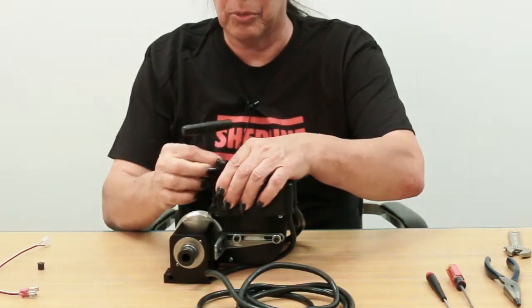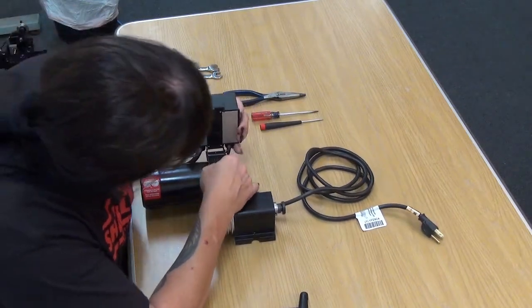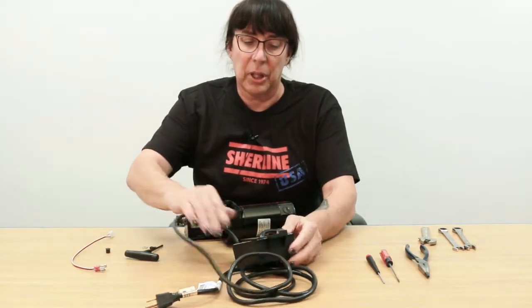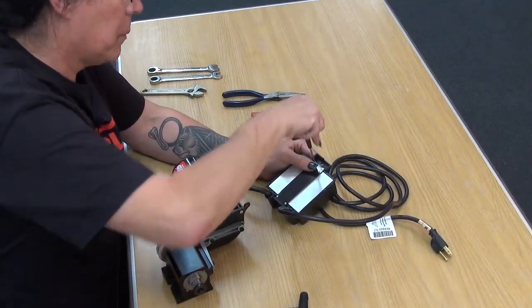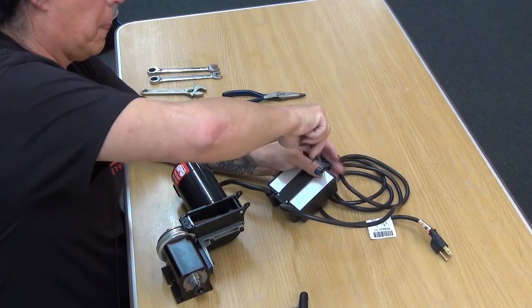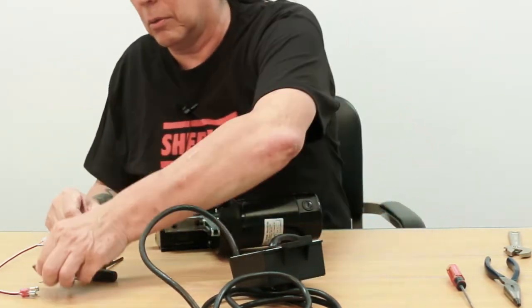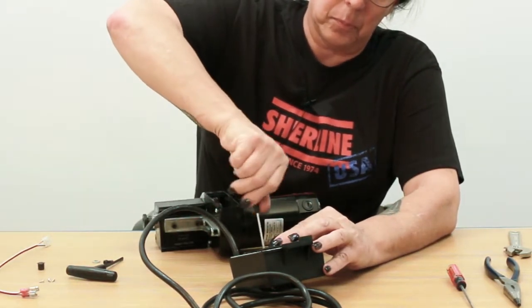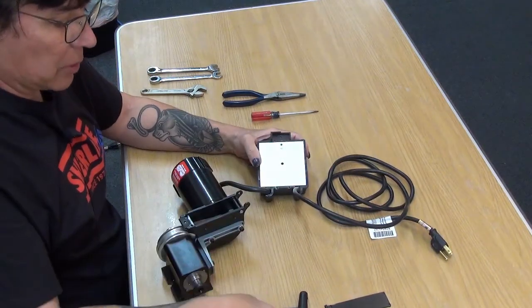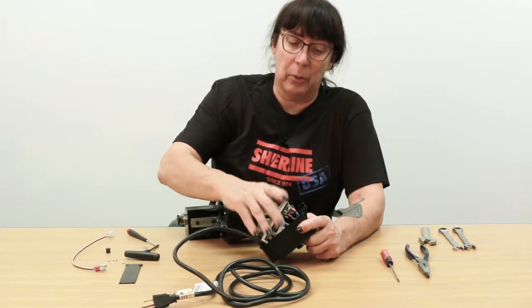This should be familiar for changing belt speeds. What you want to do is pop the little hinges off, just like that. That allows you to get to the bottom. Take your small Phillips screwdriver and remove the four Phillips screws holding the retaining plate on. Don't lose them — they're shiny and they disappear in carpeting. Now the easiest way to get the actual speed control out of here is to take the 10-32 bolt that holds the cover on and thread it right into the speed control, just a couple turns. That allows you to pull it right out.